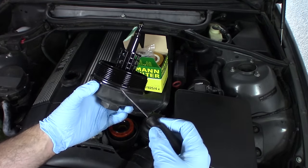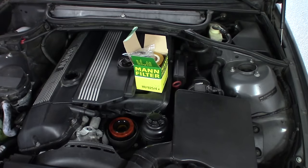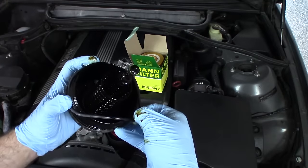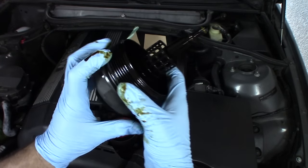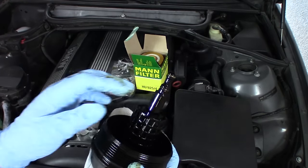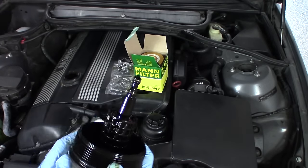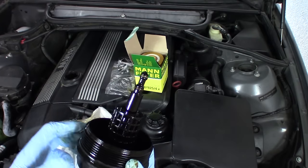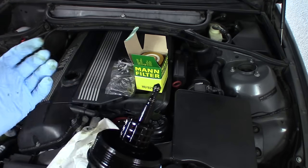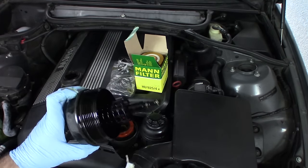Use a little pocket screwdriver to lift out the old o-ring and get a new one — it sits down in this little groove here. I want to point out that there are two more o-rings on here that should be replaced. I was meaning to replace these on this job and I just kind of forgot to order them, but I'll dig up the part number and put it in the description. It's a good idea to do this because if these don't seal anymore, your oil filter is kind of not doing anything. I think I have 170,000 miles — it's probably about time to change those.